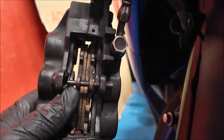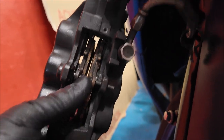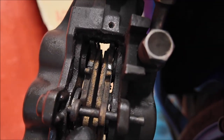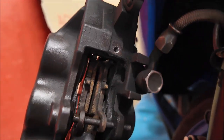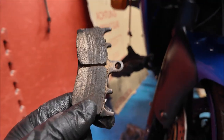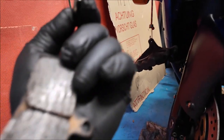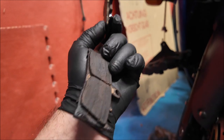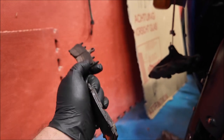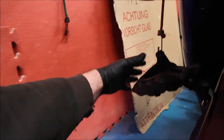Split pins out. I can't really show you me taking that pin out because two hands are required, but that's the way it works — split pin out and then that pin just goes out to the outside of the brake pad. There you go, everything removed. They weren't terrible but while I'm in there why not get them changed — they've got a bit of wear and they're probably a good year or even two years old.